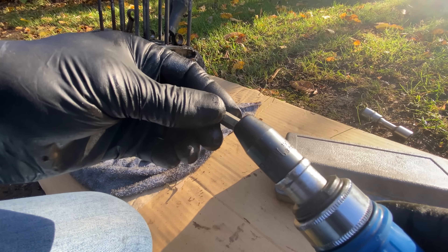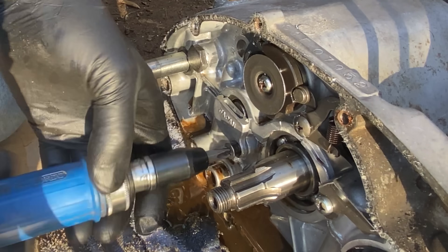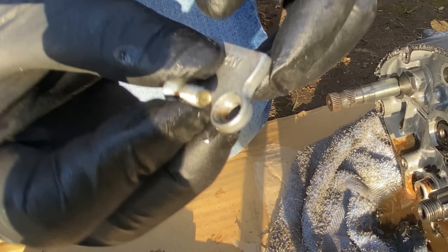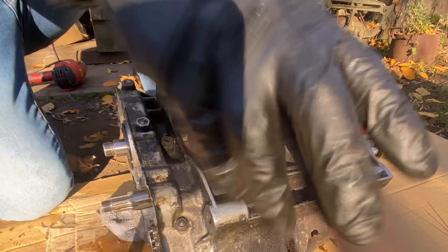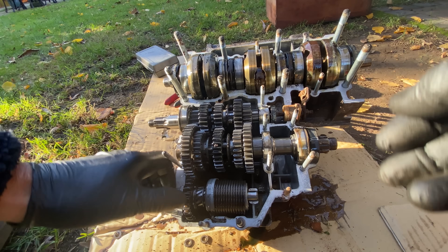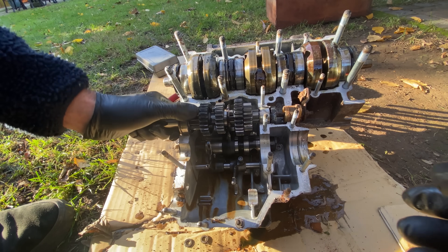The screws holding the oil catcher and selector drum in place are very tight so I use my impact screwdriver — this makes light work of it. I've seen a lot of these oil catchers with a broken stub where people have left them on the engine when they split the crankcases, but it's really important that stub is there because it feeds oil into the gearbox. With the crankcase nuts undone the bottom case just lifts off and you can see the crankshaft and all the gears inside, so I lift out the gears first and then the crankshaft — it all looks in really good condition.